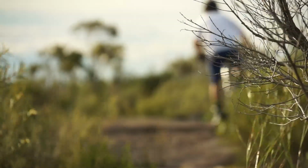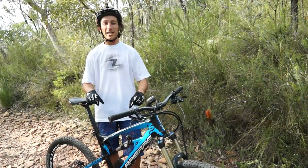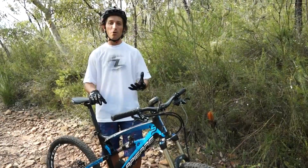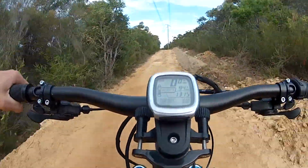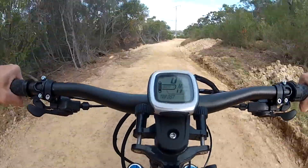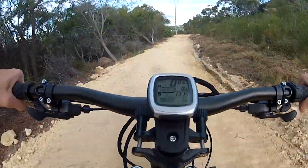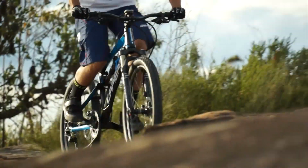If you keep pedaling along and suddenly you hit a few little impacts, the fork sensor will detect that and that will communicate to the rear shock to engage a more moderate compression setting. So it will still give you efficient pedaling, but it will start to absorb the bumps a little bit better. Now if you stop pedaling altogether, or the fork sensor detects that you've started to encounter some rough terrain, it'll open up the suspension entirely to allow the suspension to work as best as possible.